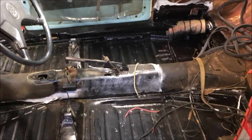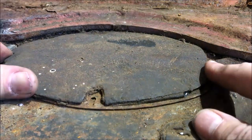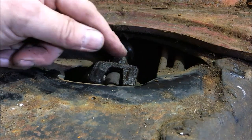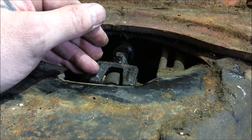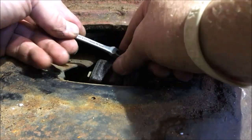We're at the back seat of the car. Before getting under the car to disconnect anything with the transmission, there's a Phillips screw here under where the back seat sits over the tunnel. Slide this up and here's the shift bushing I was talking about, and that's the nose cone to your transmission right there. You want to loosen this up and pull the shifting rod back slightly. You have to take your shifter out first — it's two 13mm bolts — and lift it out of the way. Then come back here and take an 8mm wrench to turn this out.